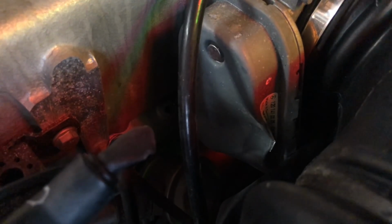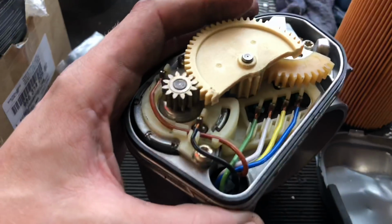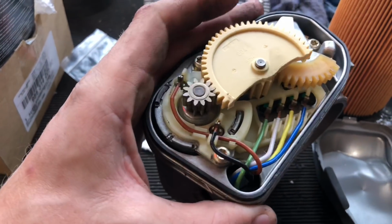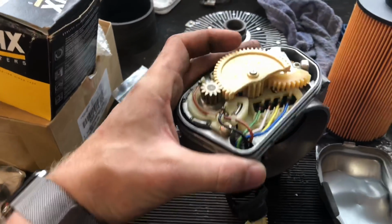Hearing the throttle bodies. Oh, I think we may have a bad throttle body, actually. I didn't realize how hard that got pushed into the cover. I might pull that off and see if it's seized. I didn't see that before. Well, that might be part of my problem. Shoot. I'm gonna try to super glue that back together, and then I'll start shopping for a used one.